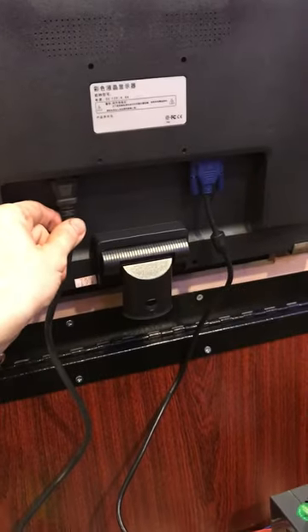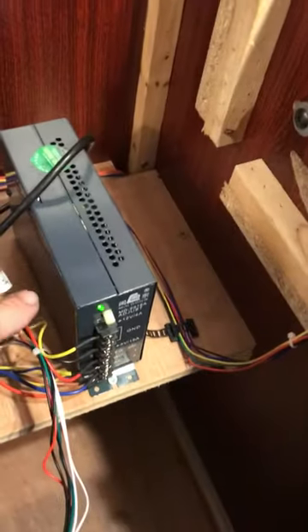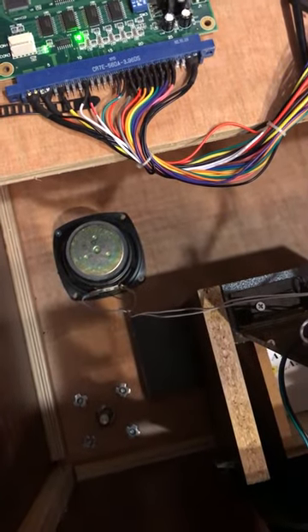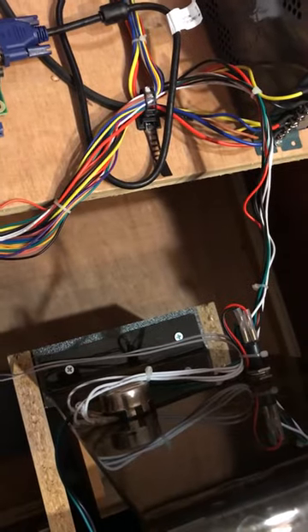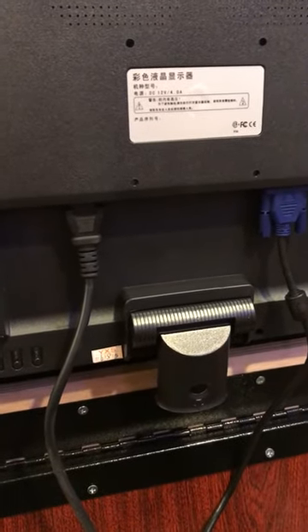Once inside, check your cable to make sure you're getting video. This is going to be your power. You want to make sure you've got a green light on your board and a green light on your power supply. Sometimes something may have come loose on a speaker — that would be down here. If your red button does not work, you may have one of these plugs that came loose. If your volume control doesn't work, you may have had one of these connections come loose. The majority of the time it's just a connection that came loose. Every once in a while you'll have a power supply, board, or monitor that goes out, but that's generally about all you have to worry about.